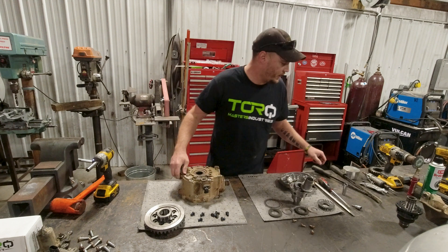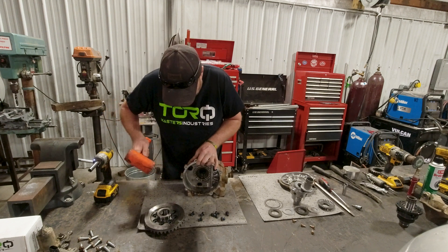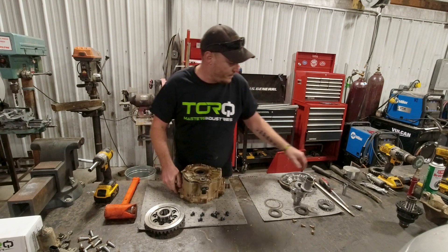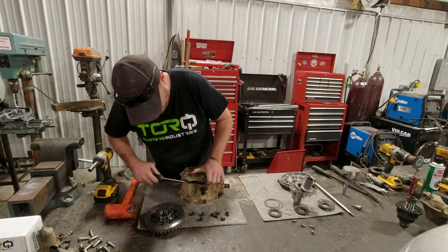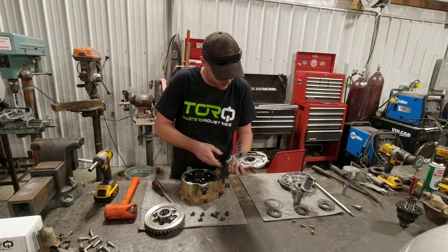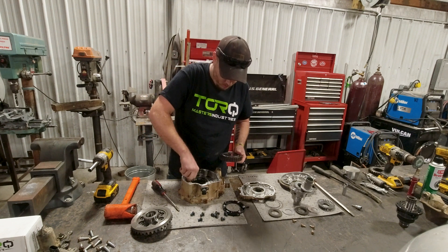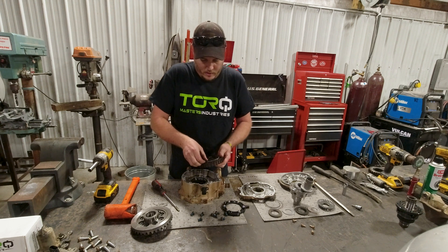This side's a little bit more tricky to get off sometimes because it is siliconed on - it doesn't have an O-ring. But Can-Am put a couple of tabs on there for you to be able to tap off. No O-ring to worry about tearing, just a lot of silicone. On this side of the differential you have the clutch pack - this is what we've got to get to. You've also got these roller balls that apply pressure to the clutch pack. We're reusing everything - this is just a drop-in setup.